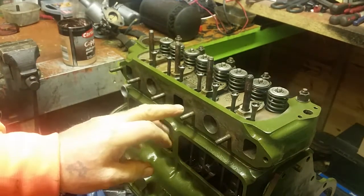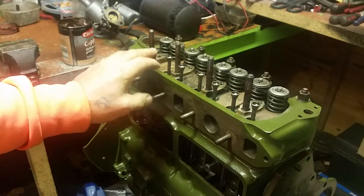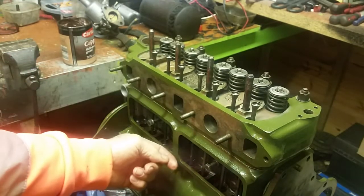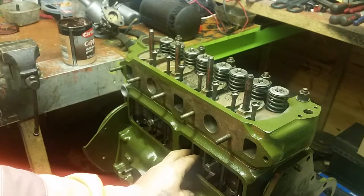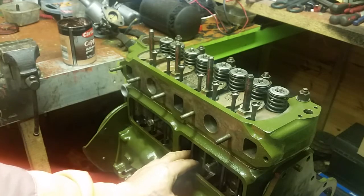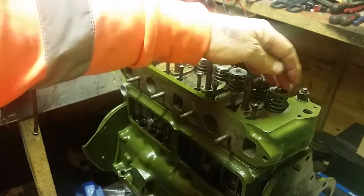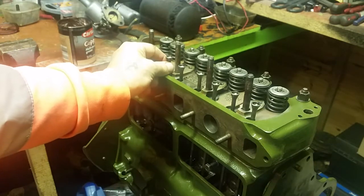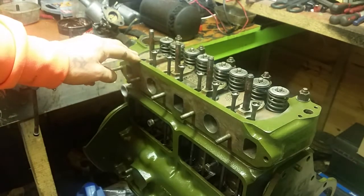Obviously in this case I can only put seven in until I get the other push rod sorted. Now you can't see very clearly on this video, but this one is higher than that one - don't worry about that, because the valves open and close. The cam turns at the bottom of the engine, it pushes the cam follower up - what we've just slotted in - and that in turn lifts the push rod up and down. That rocks the rocker, which is going to be on here, which in turn opens the valves. All those valves are closed now - the valve will open as this push rod comes up.